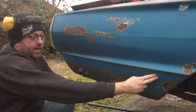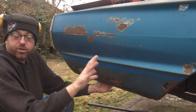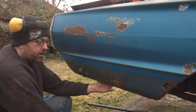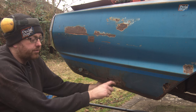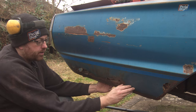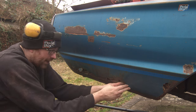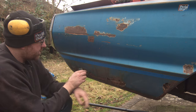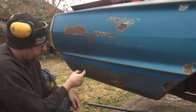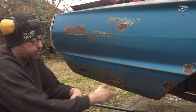We're going to cut along a line where I've put painters tape down to get a nice straight edge. The other one I could freehand because it was a smaller and oddly shaped panel, but this one a nice straight line should be easy to replicate. We're going to have to work out how to separate it from the skin at the bottom, because in here you can see lots of bits of rust. This has previously been sealed up with filler — I actually can't get it out — it's so thick, again nearly half an inch. At the back it's all just packed full of rust, so all of this is going to have to come off.